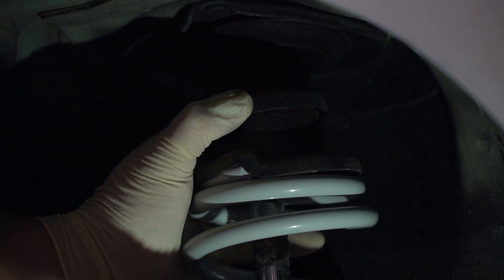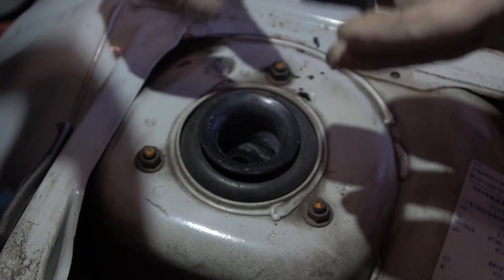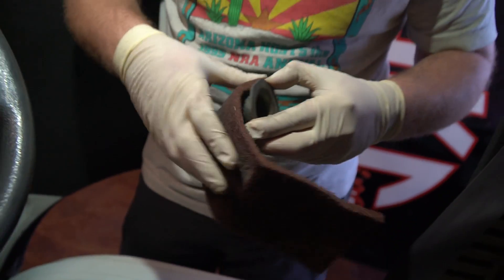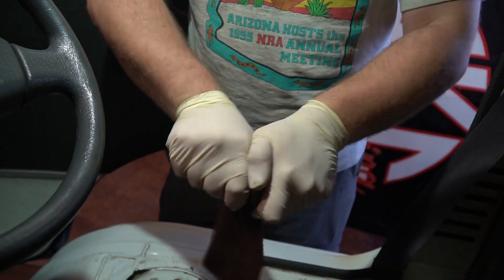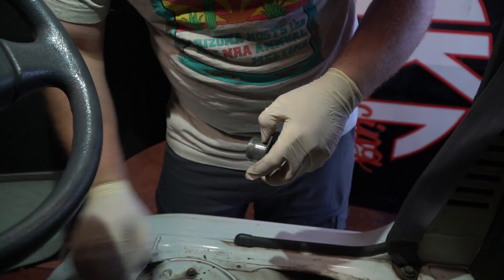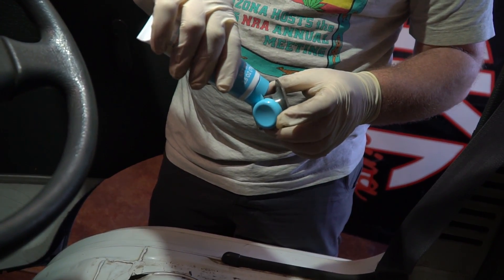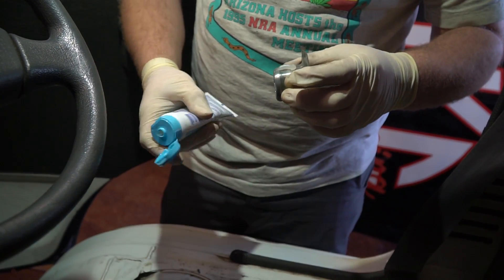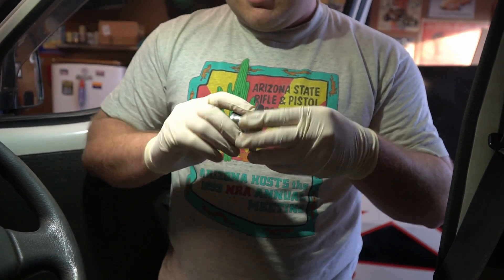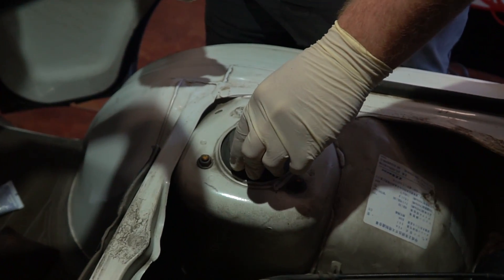At this point, you're going to need to jack up your second jack again. Before the top of the strut comes through, we're going to remove this metal bushing. To make insertion easier, take some Scotch-Brite and clean off any of the gunk on the outside of it. Then to lubricate it in this rubber grommet, you can take some petroleum jelly, KY jelly, some grease — whatever you've got laying around. Lubricate it well so that it'll slip in and out of the rubber grommet easily.